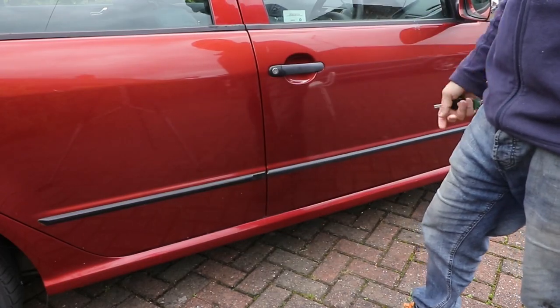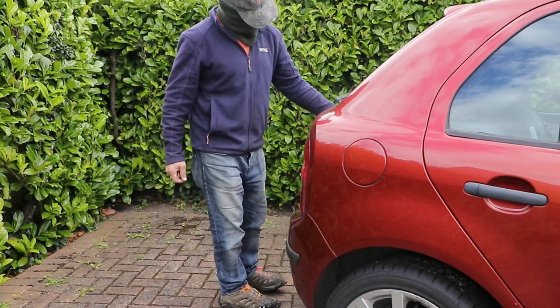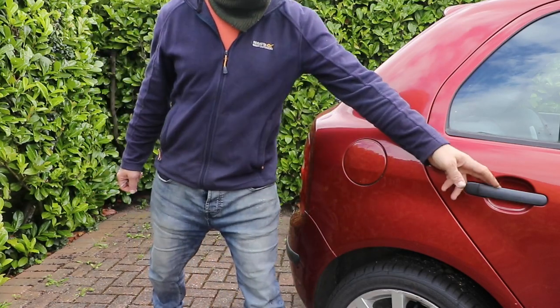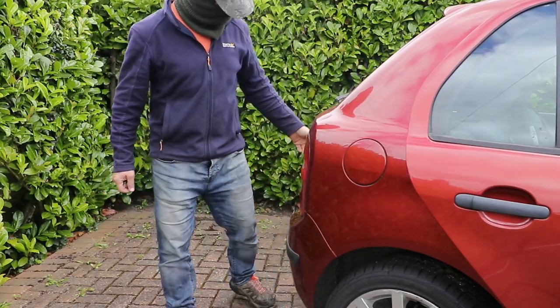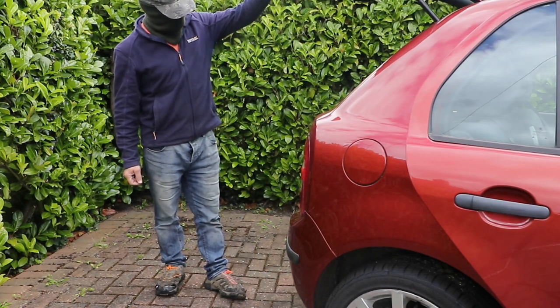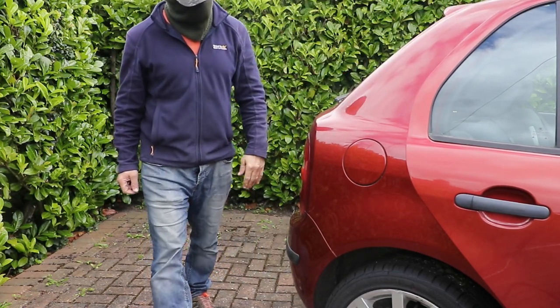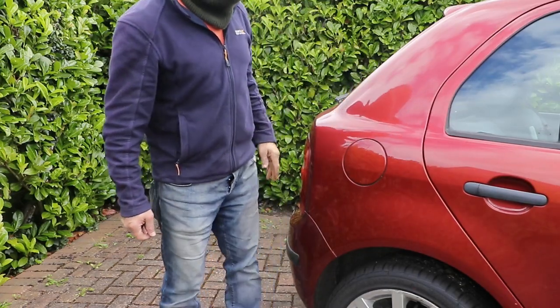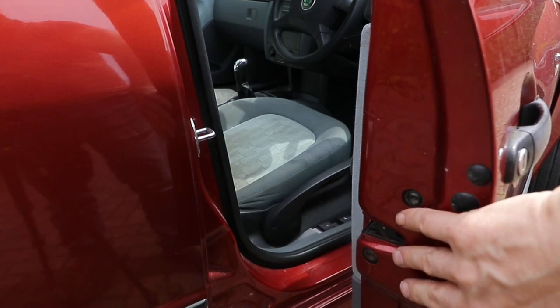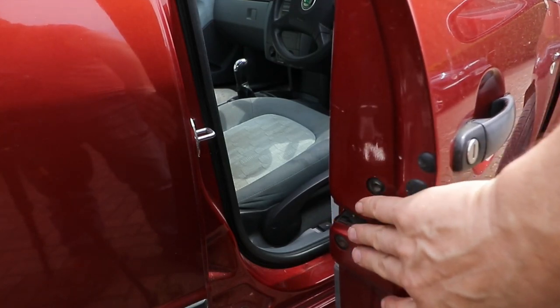When I opened the front door with the key fob the other day, I couldn't open the boot. But I could open the boot after I'd opened another door. As you can see, it may lock randomly on its own, or unlock on its own, often intermittently. These, and possibly other various faults, can be attributed to the driver's door lock, and in particular the micro-switch within it.